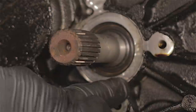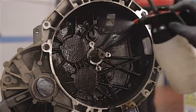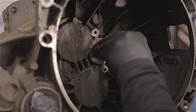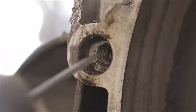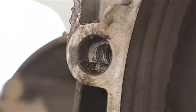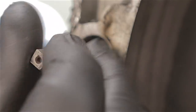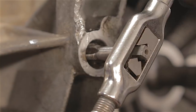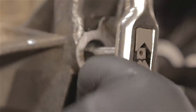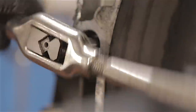It's a good thing the gearbox input seal isn't leaking. This gearbox casing certainly needs a lot of brake cleaner to clean all this up. This bolt hole at the back of the bell housing where I had trouble getting the bolt out — a few of the threads have come out of it. I'm going to run a tap through it. I'll put some spraying oil in there and stick the tap in to make the thread a little bit better. Winding it backwards and forwards — I can feel a little bit of resistance but not a great deal. I think it was a lot of the corrosion on the bolt that took the threads out. They've probably never been out before. At least this should clean the threads up enough.